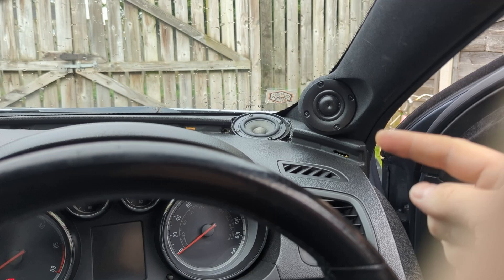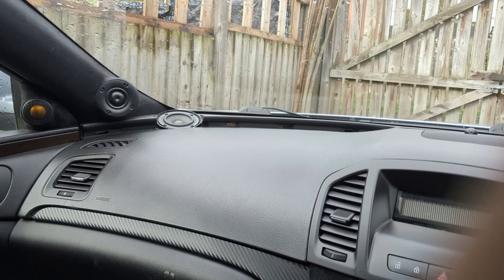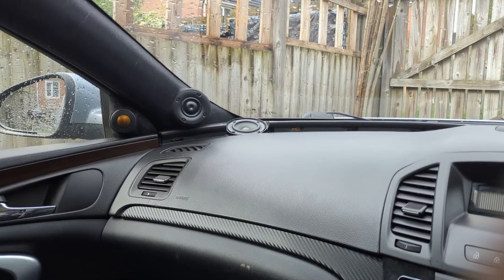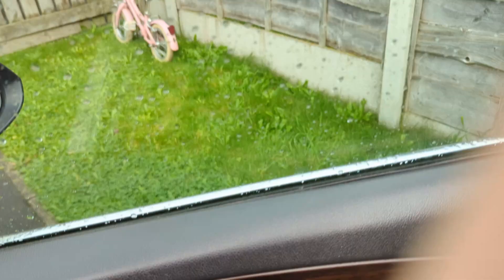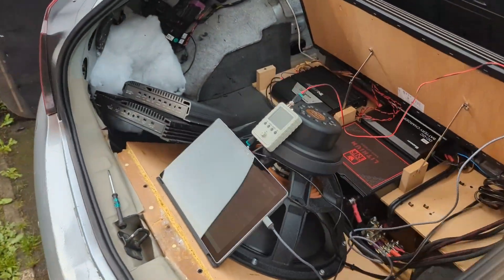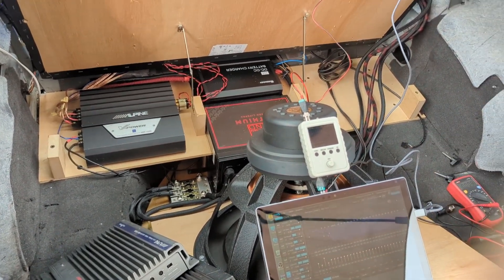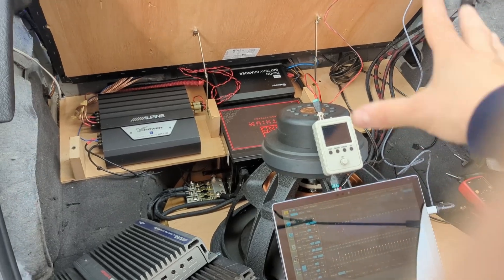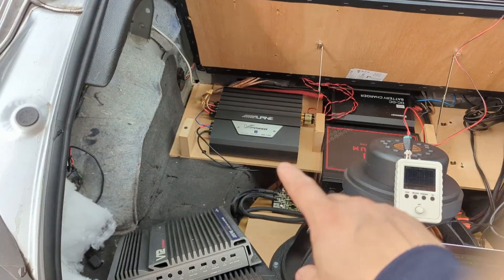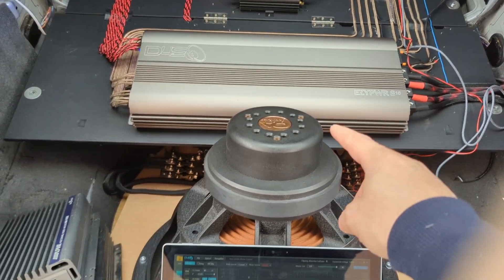The reason is sensitivity. My speakers are 93 dB sensitive. One watt gives 93 dB; add the other side — roughly plus 6 dB — and that's 99 dB with a single watt. So you absolutely do not need 100 watts for tweeters. 95–99% of your power requirements will be for your subwoofer. Mids and tweets need very little; mid-basses need a bit more. A 2.5–3 kilowatt amplifier for a 1 kilowatt subwoofer means you will never clip it.